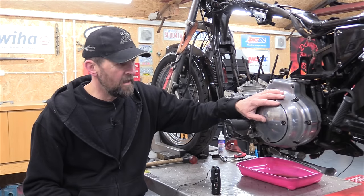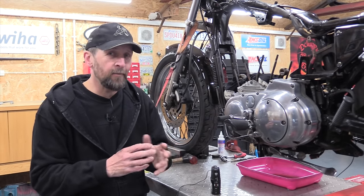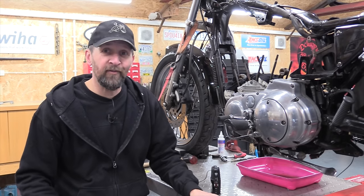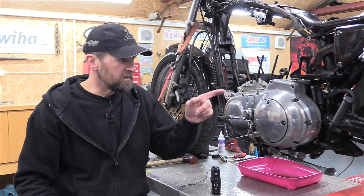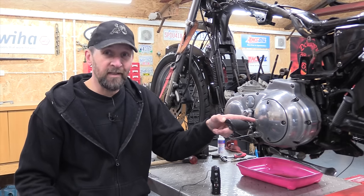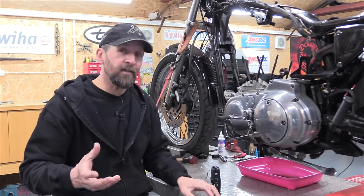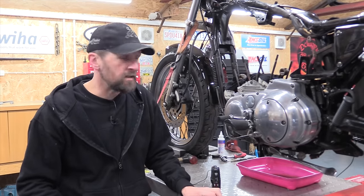The clutch that's in there at the moment is held in by a diaphragm spring. They need a special tool to take them off. I don't have one and I'm not about to buy one for 70 pounds — and yes, I know you can buy Chinese ones for 30 pounds, but it's still 30 pounds I don't need to spend because I'm going to use that tool once every five years. I don't take clutches out of Sportsters very often; they just don't go wrong. So I'm going to make one. You can make a diaphragm compression tool for about three pounds in DIY shop stuff. I need to measure a critical diameter inside the clutch first, then I'll know what bits to order, and in the next video I'll bring you a DIY clutch compression tool — need a tool, make a tool.